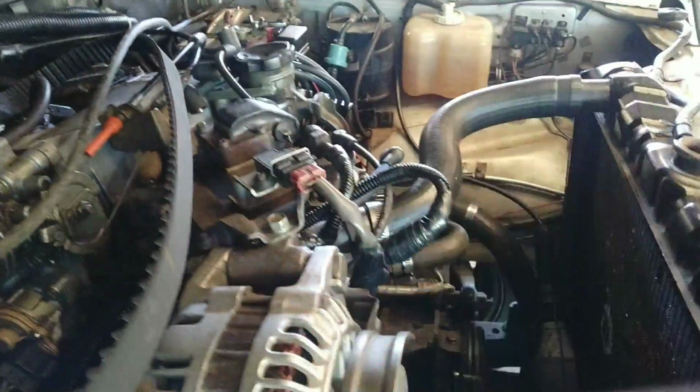I can't really show you guys. We have to weld up one of the threads because it's a helicoil now. This bolt is an original because there's a nut underneath. Dad accidentally went the wrong way and over-tightened the bolt because he was trying to crack it, but he was failing to crack it because he was actually ripping the thread out as he was going the wrong way, and he didn't realize he was using so much strength and it was requiring so much force to loosen it. It's like, what the hell? If he went any harder, he probably would have felt the thread pull straight out. It would have suddenly gone loose, and then why isn't the bolt coming out? He's actually very lucky to get the bolt out of the hole, because that would have been very difficult to get out if he had pulled the thread.